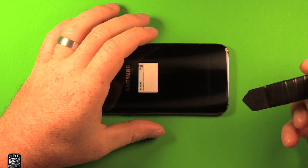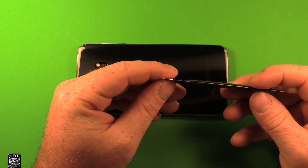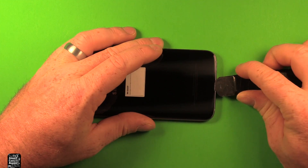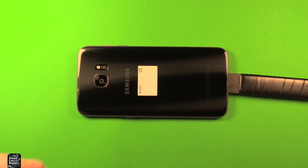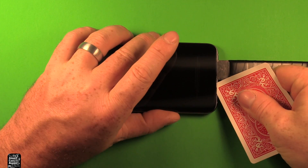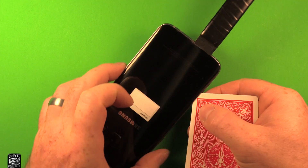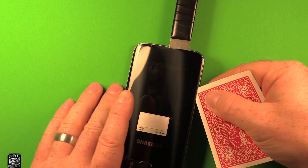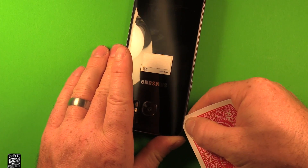Now that you've heated it up, we're going to start right in the bottom here with this really super thin pry tool — I'll link to this in the description. Then what we need to do is use playing cards. I would use a deck of playing cards because they're really slippery and thin, and you can get under here and work your way around. The reason for using cards is because of this edge right here — you'll break this if you don't use a card like this or something similar. If it's hot enough, you should be able to just slide right around.